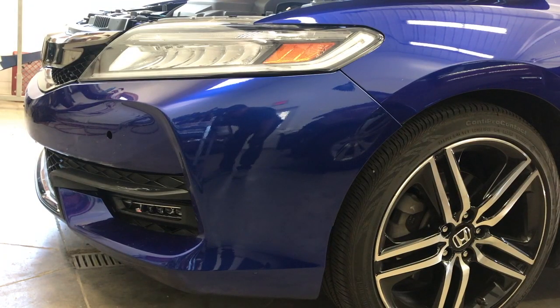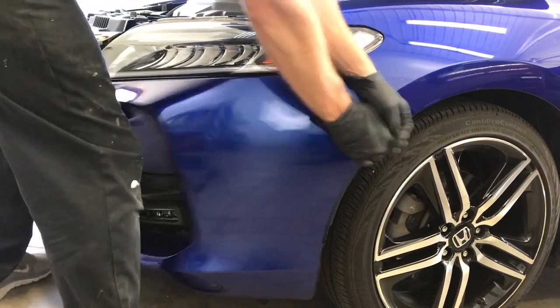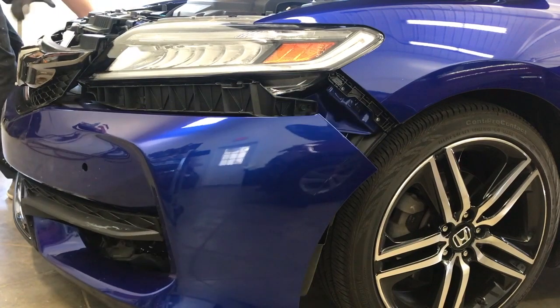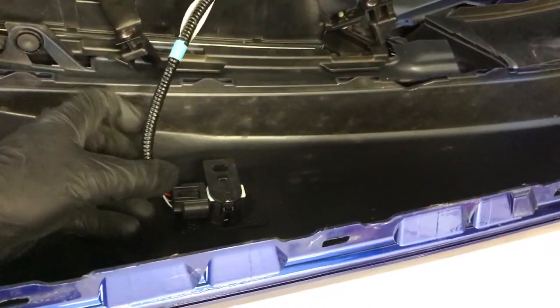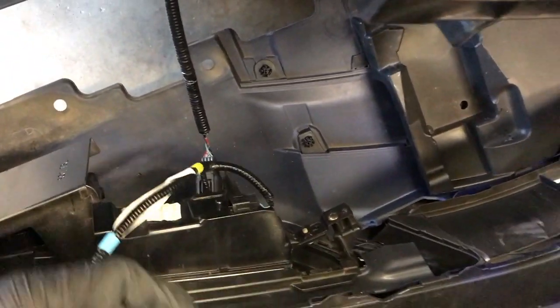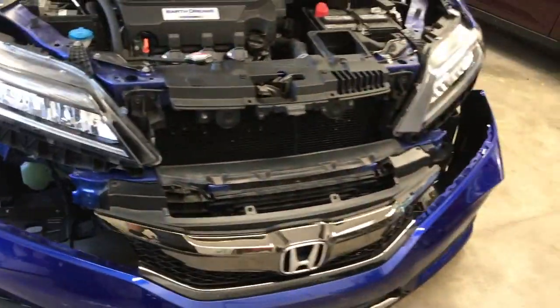From this point you're just going to go to each side of the bumper and pull directly back. When you're taking the bumper off, just be careful not to pull it too far before you unplug all your wires. This one has park sensors, so make sure you unplug those, and same with the fog light wires — both can be removed just by pushing on the tabs of the wire plugs and pulling out. But that's basically it guys — that's how you take the front bumper off. Thanks for watching.